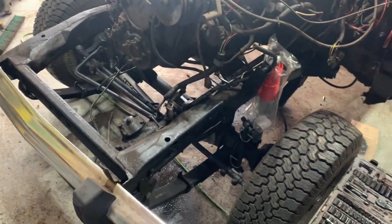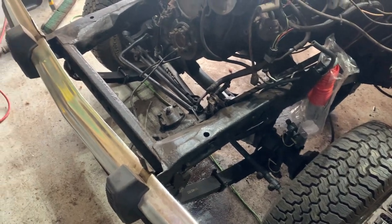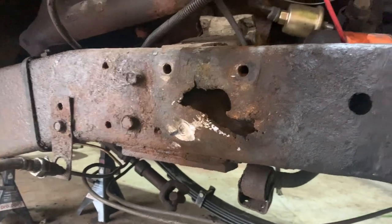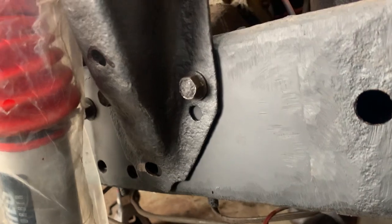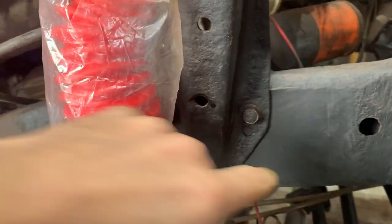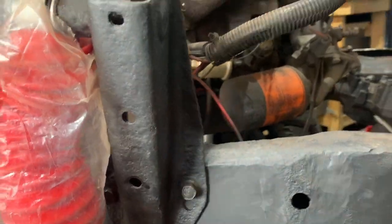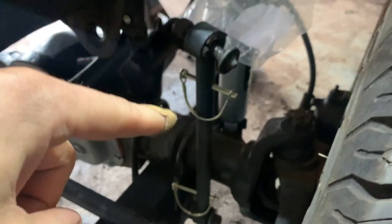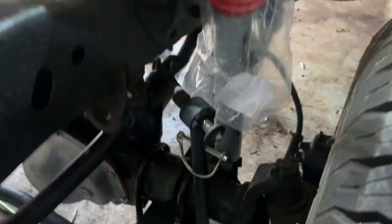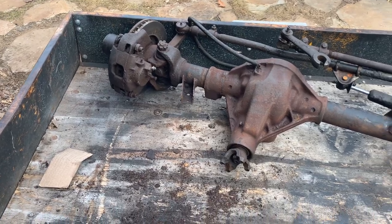The first thing you'll probably notice is the axle is back in. A big part of the suspension and lift kit is already on — my shocks are on, I fixed both sides of the frame where the shock towers bolt onto. Here's a closer look at the actual frame and how I bolted that back in — this part here is all new metal, very strong. I haven't fixed the bottom part of the frame yet; I wanted to get my sway bar lined up. At the time I thought that's where the mounts go for the sway bar, but it's actually where the bump stops go. Here's a closer look at my sway bar quick disconnect links — I'm going to try and get new bushings for them because they're a bit wallowed out, but they turned out great. I spent about 50 dollars.